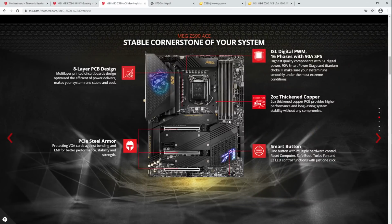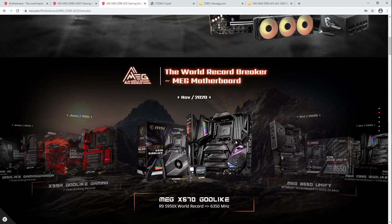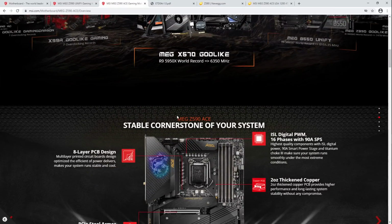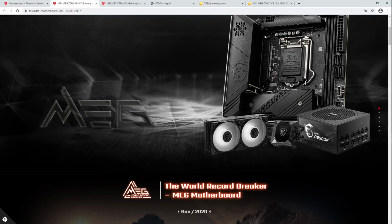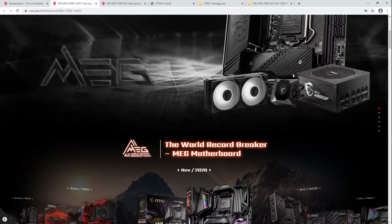Okay, I can't see anything about any fans, so I'm going to go with they didn't put fans in this VRM, which is the correct decision to make. On ITX boards, having fans in the VRM heatsink is also totally reasonable, because the VRM can't be big enough, and you can't put a big enough heatsink on it in an ITX form factor and still get reasonable thermals. It's just too small. So the fan on this is totally reasonable.